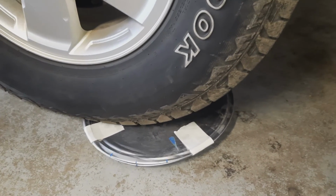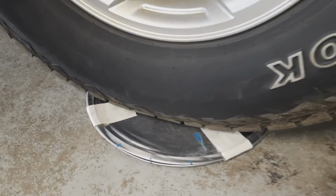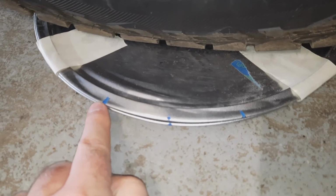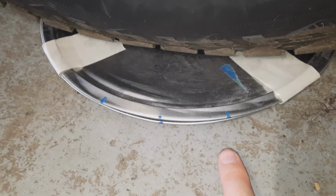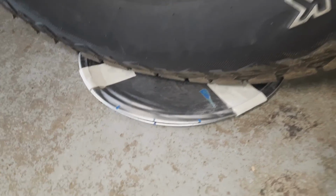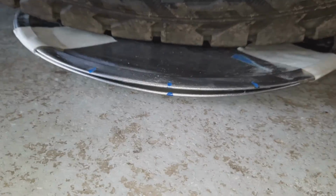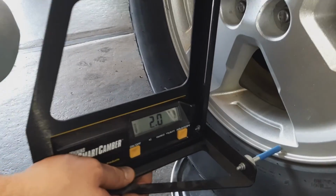They're taped together. And then on the front edge, he's made some marks on them where the middle mark is straight, and then there's marks at 20 degrees so that we can turn this and measure the caster based on what the camber is at those different marks. So we're going to get the Escape on top of these here, take some measurements, and see where we are.